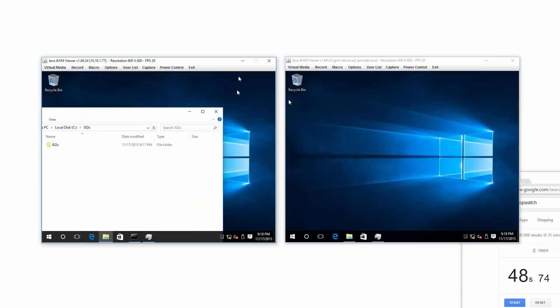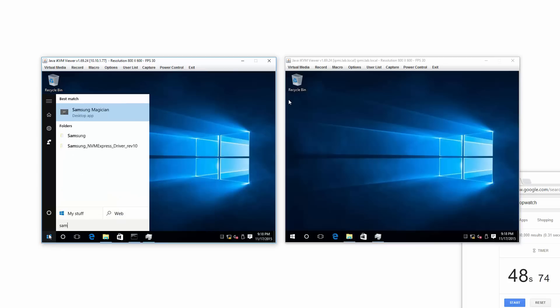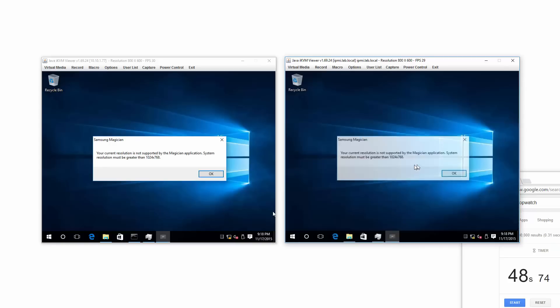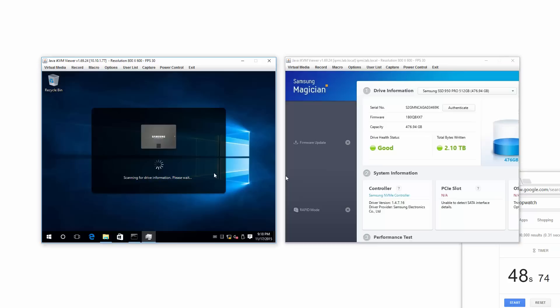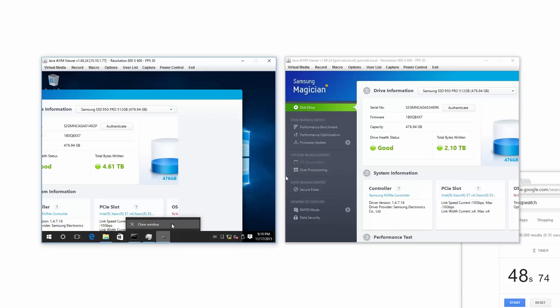I'm quite pleased that the Samsung 950 Pro is awesome in any home lab or work environment. If you're going to abuse it year after year in a RAID array or caching role, abused 24/7, you are going to need to watch how much data you're writing on this drive. This is the latest firmware on the 950 Pro. PCIe x4 is important on the motherboard to get the full speeds — you are not going to be able to replicate what you saw in this video with an older motherboard.